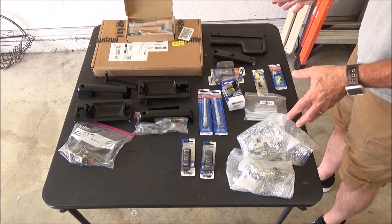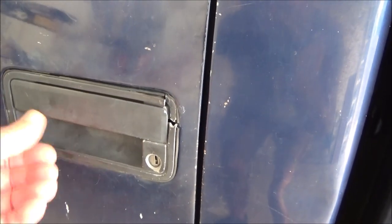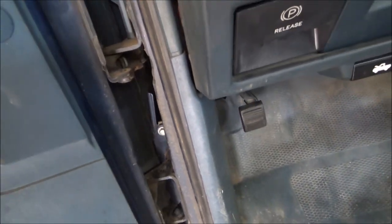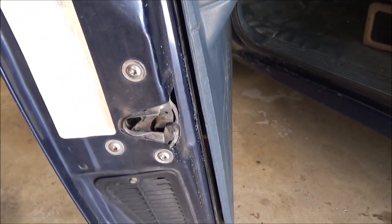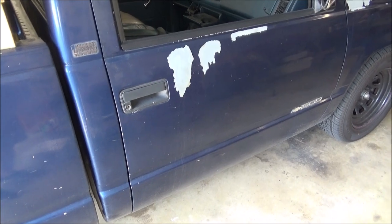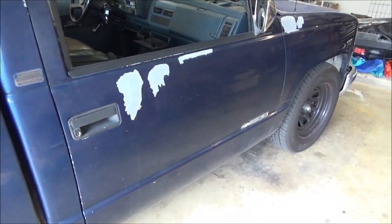Let's take a look at the doors themselves. If you have your original door handles in, yours probably look like this — broken. This door is hard to open. The striker bolt is worn out, the roller pin is worn out. The passenger side is worse than this side, and the pins are worn out, so the whole door is loose — it all needs to be replaced. The original latches are worn out too. This door has a hard time shutting sometimes, and even if you hit it hard, sometimes you have to butt-slam it. The passenger side door is actually worse, which is weird — if I hit a big bump, the whole door kind of bounces because the latch is so worn out and the pins are worn out.